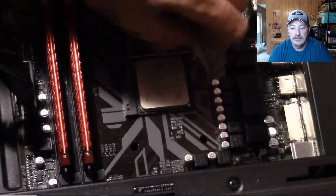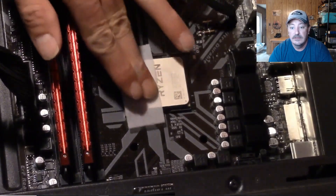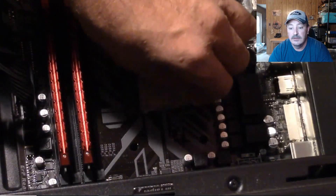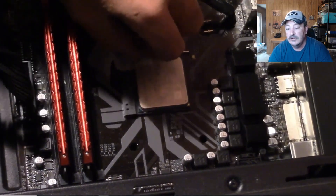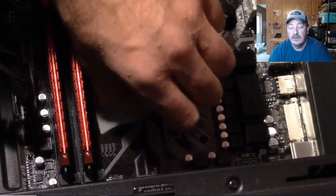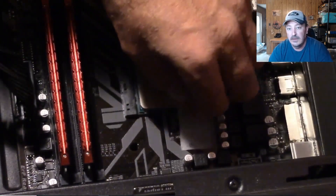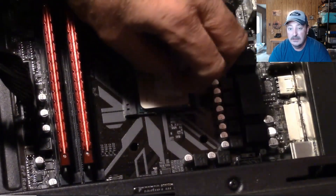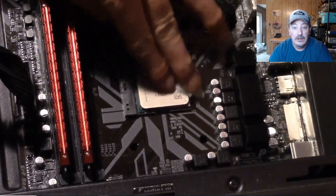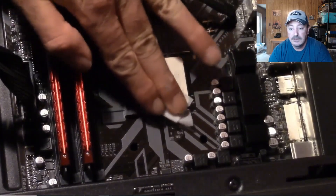As you can tell, I went through several pads to remove the thermal paste — it does take a while. I usually start with a Q-tip with alcohol to get the bulk off, then use a coffee filter with rubbing alcohol to finish up, since coffee filters don't leave fibers behind. These alcohol pads do come in handy if you have them.